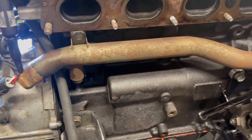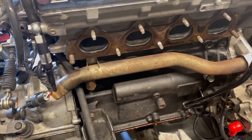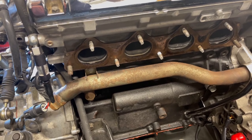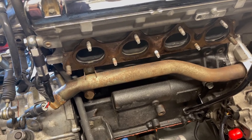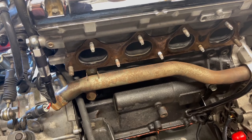We're going to do the water coolant areas. I'll show you exactly what I'm planning to do here. The water pipe here — that's what we commonly call it — is functional, completely fine to use, but it doesn't look so pretty. It's got some surface rust. So I'm going to take that out, bead blast it, and then I actually do a clear coat on it as well to help prevent rust in the future. I use a high heat, usually VHT brand clear coat, and that way it bakes on well with the heat.